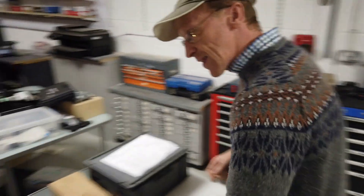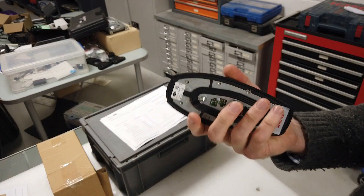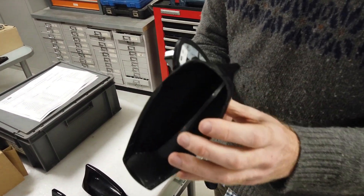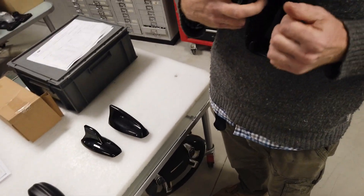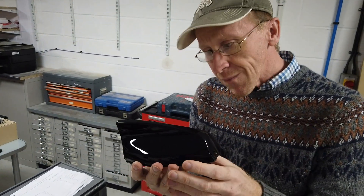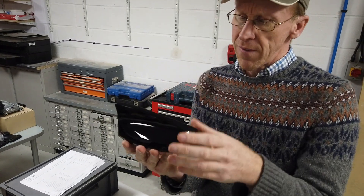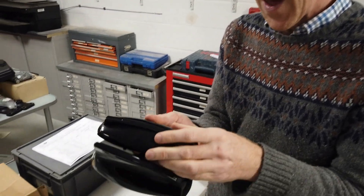So why are we looking at all this? We decided that on our Range Rover L405 - our big Range Rover Vogue - we have an aerial that looks like this. And it was Craig who said he wanted to replace it. So we 3D printed it and then had them made. We've designed a sort of snap-on aerial cover. Craig drove his car around for a few months with our 3D printed one and he said it made no difference to any signals or reception. I think that's because most signals are fairly transparent to plastic.